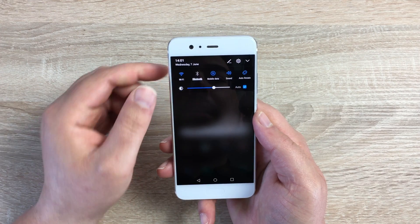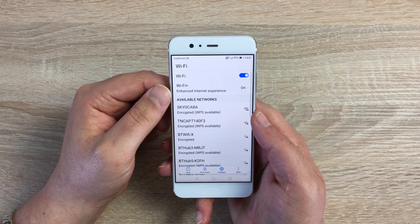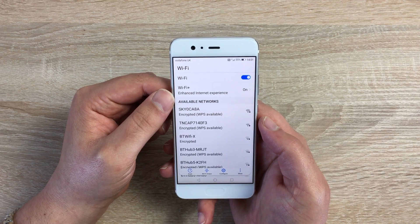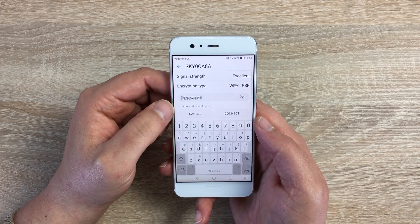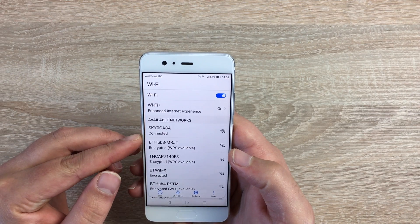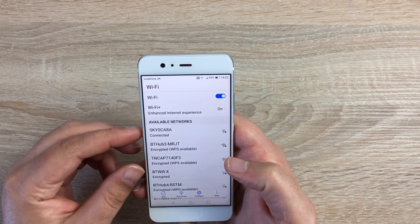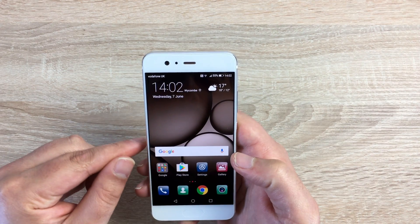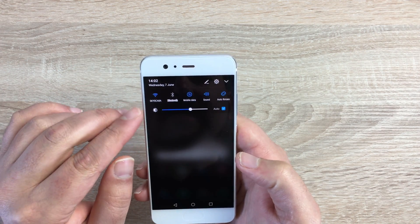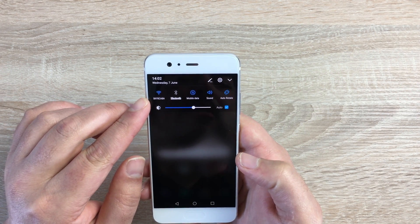Slide down with one finger and at the far left you'll see the WiFi icon. Press and hold on this to launch the WiFi system menu. Inside here, connect to one of the networks you recognise. Mine is the top one here — Sky — and it will ask you to input your password, then hit connect. Once it says connected, you'll be using your home, public, or office WiFi and saving your mobile data. You can also see the WiFi signal up at the top.